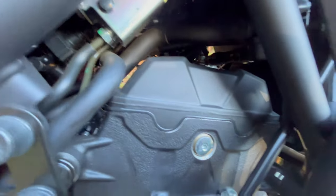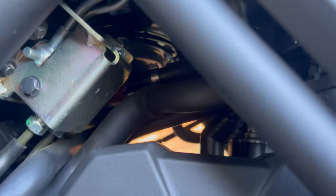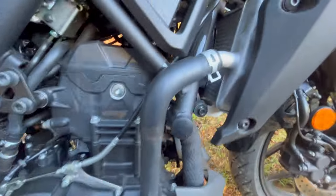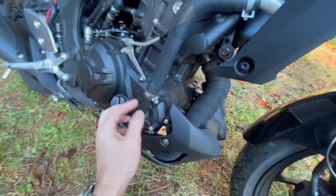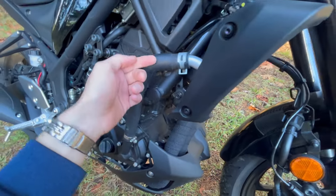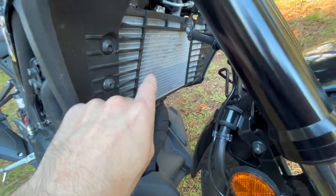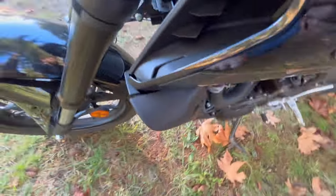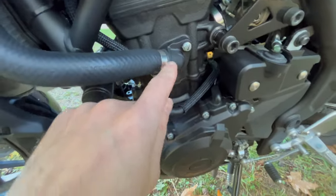This is the cylinder head. Those plastic knobs in there are the spark plug leads. If we follow the wires there's an ignition coil. That knob at the bottom — there's the bottom of the gas tank where it gets fuel. If we come around, we see here's the water pump that pumps engine coolant. There's a thermostat that opens or closes to send hot engine coolant into this radiator, and then the chilled coolant comes from the other side of the radiator back down and re-enters the block over here.